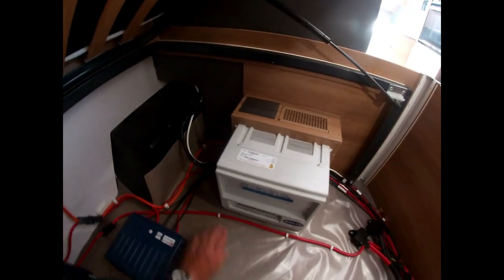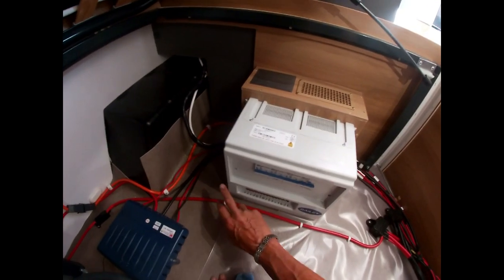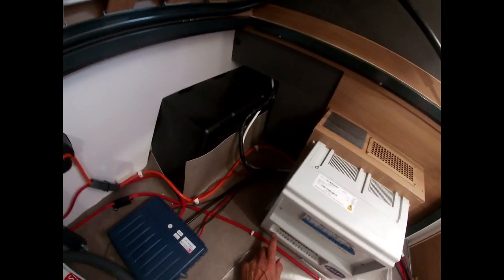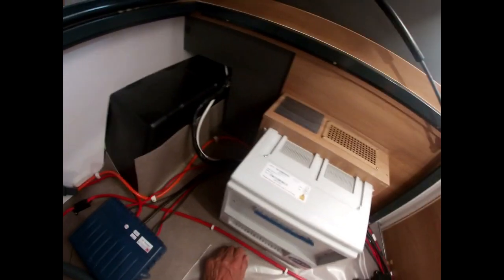And that important part is this unit here, which is commonly known as a power supply unit. If I split this three ways, one's through there, one through there, one through the back, I've got all my 12 volt fuses down there, so that will identify my lighting circuit, 1, 2, water pumps, auxiliary sockets, etc, etc.